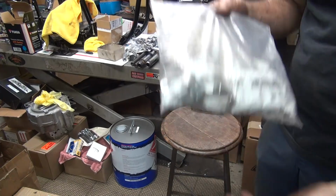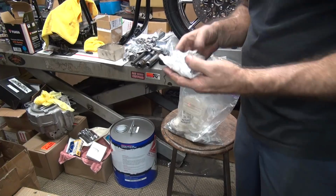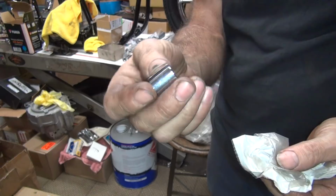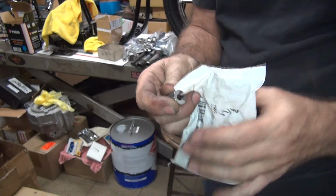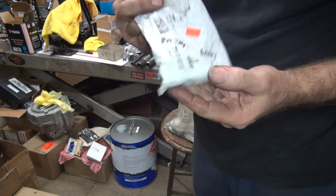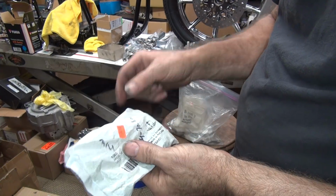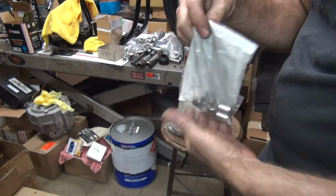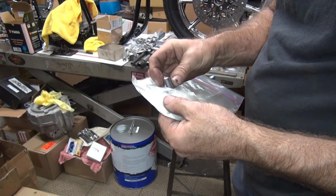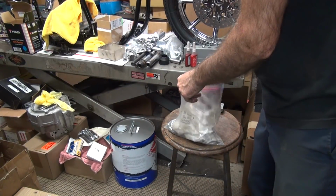Need some wheel weights. There's the wheel weights. These go on over the hub, over the spoke. So these are Buchanan. The cheap import ones are almost the same price as buying the real McCoys, so I buy the real ones, the BTEs. This one's a 3/4 ounce. I don't know what I need yet. So they got 1/4, 1/2, 3/4, and 1. That's your choice.